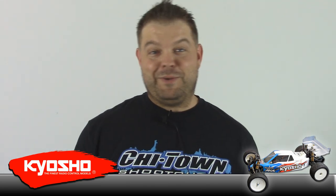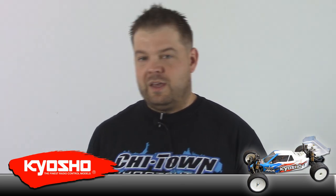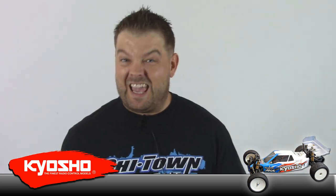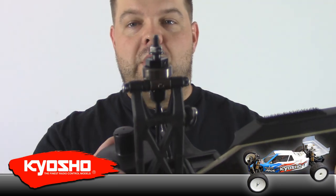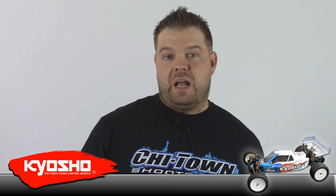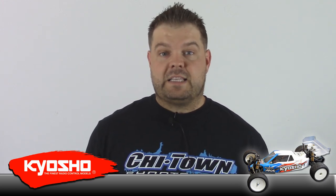So if you're thinking about trying this car, I really like the AKA wheels. The Kyosho wheels also fit really well. One downside to running AKA wheels is the rear axles just aren't long enough to run a lot of the associated or AKA wheels — you'll only get a couple of short threads on there. I run Durango wheel nuts specifically because they're serrated and they work really well. I don't care for Nylock style wheel nuts because over time the Nylock wears out, the wheel nut comes loose, and sooner or later you'll spin a hex inside a wheel.